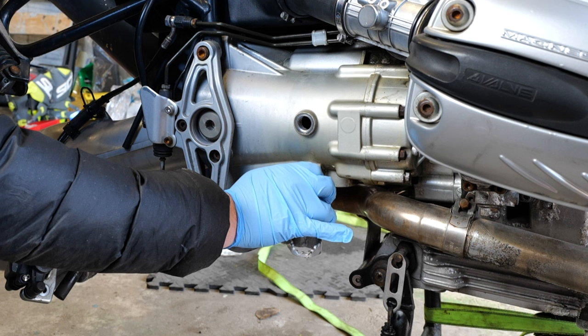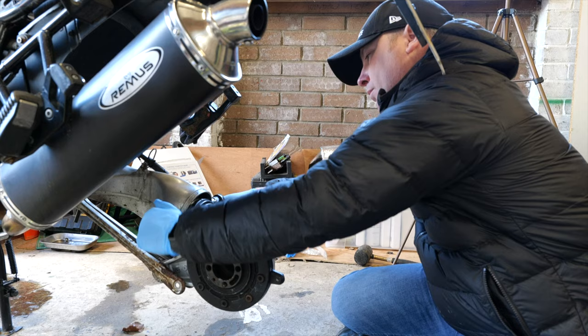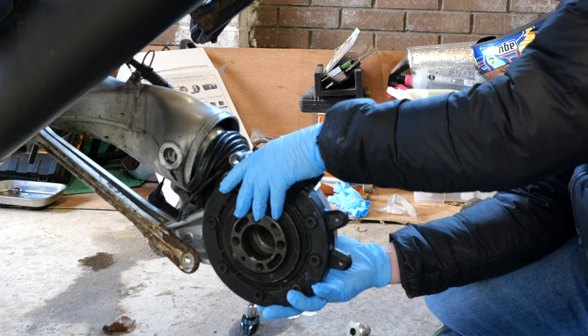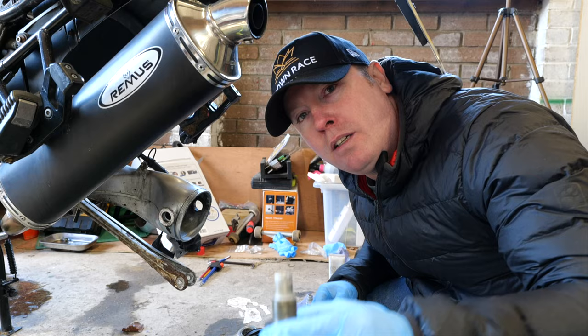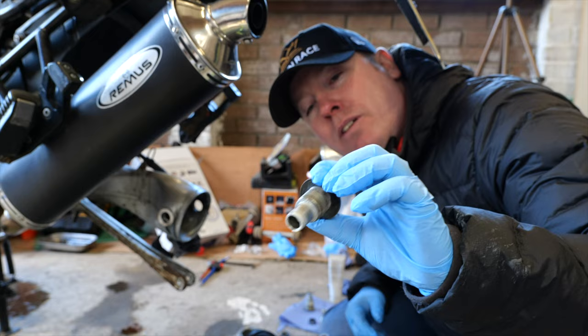With that complete I moved on to the final drive and removed it again — just needed to inspect it after last week's drop, but more importantly I need to sort the swing arm pivot and the lock nut. This was the problem last week: you can see the big outer black bolt is seized on that silver inner and I don't know why — we just couldn't get anything on it to pull it apart.